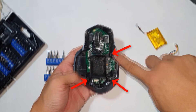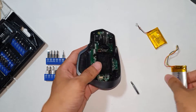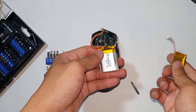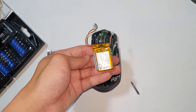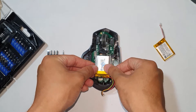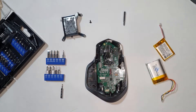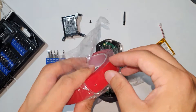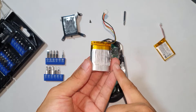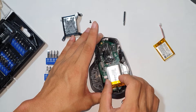There are three Phillips head screws that hold the battery tray down. Because this new battery has bigger capacity, it is slightly bigger than the original battery, so it doesn't fit inside the original hole. Instead, I'm going to remove the tray and use some double-sided tape to tape it down like that.